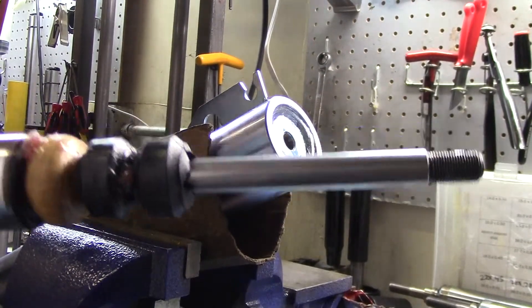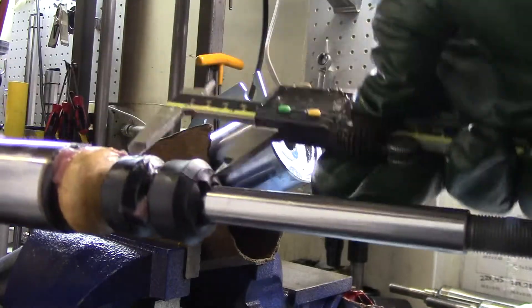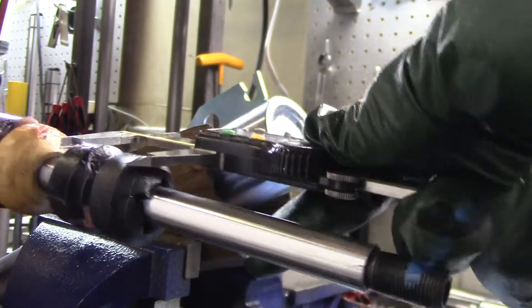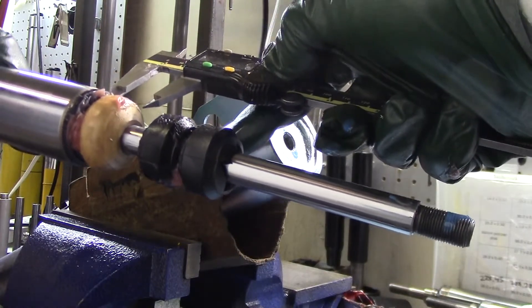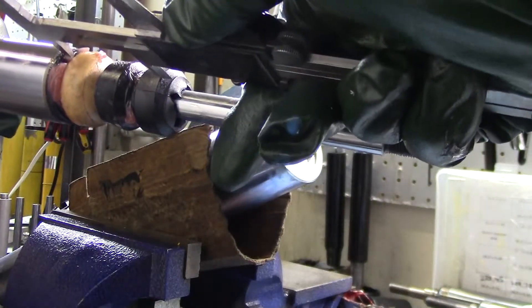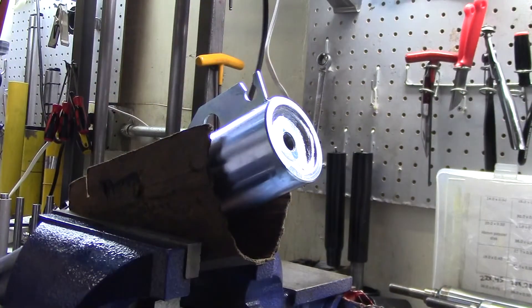Final assembly of the Porsche Cayman. I've got two soft segments for about 42mm or so, and then a short medium segment — this is the tip of the medium segment, which is about 18mm. So in total we've got about 62mm, but definitely a good bit softer than the original 70mm medium bump stop that H&R came with.